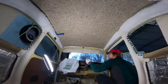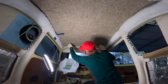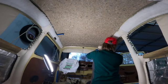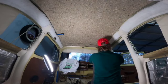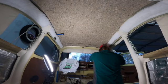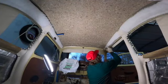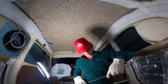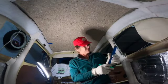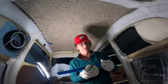I'm going to insert the bow on the driver's side as far as I can and put a marking on the bow when it stops at the very edge of the rail, then come back to the passenger side, mark the bow at the very edge of the passenger rail, and note how much is inserting. You have to repeat these steps for all of your bows. Measuring here — three and three-quarters inches.